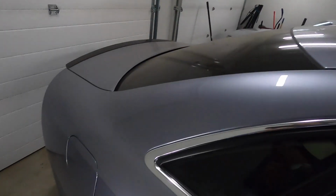I tried the priming process again, still didn't work. So I don't know if the car is just confused because there's so many things unplugged or whatever that it's not willing to prime the fuel pump. But it's not whining. It's not trying to even build pressure when I put the power on. So whatever. What I resorted to after that was trying to siphon right out of the fuel tank.